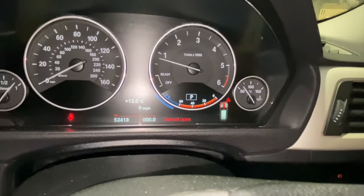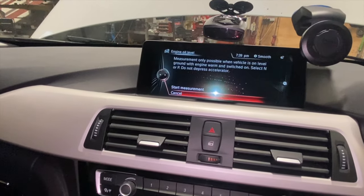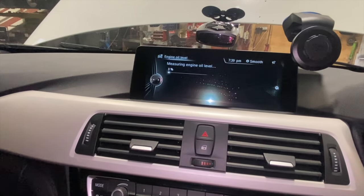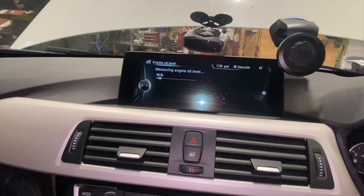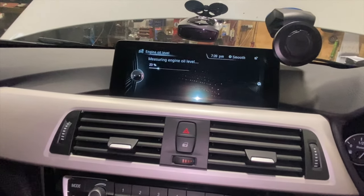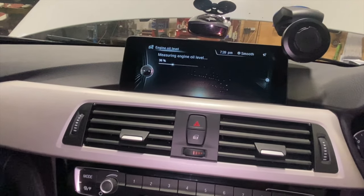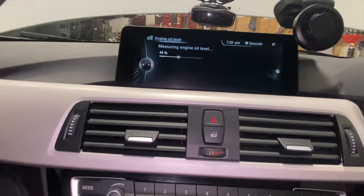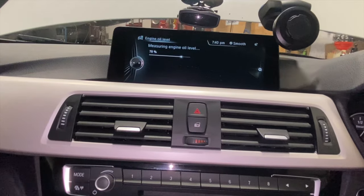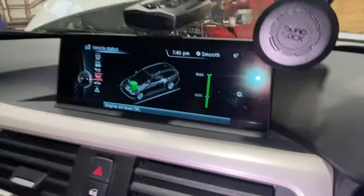It's been running for a few minutes and we've got the temperature up to about 70 degrees — the option to measure is now available. You have to go back out of the menu and back in to see the option come up. Just leave it idling, scroll up to the measurement and select it. It checks the average oil level over a certain amount of time. Once done, you can see on the gauge that having put in the 5 litres, which is what the auto data specifies, we're absolutely bang on the max — perfect.